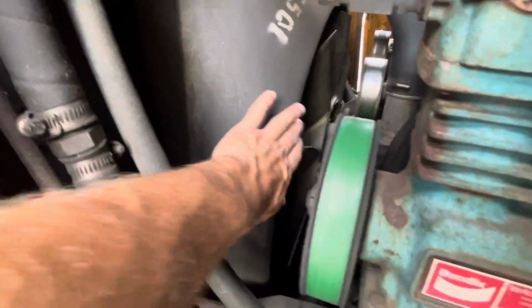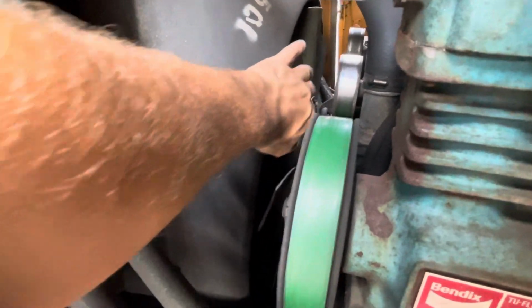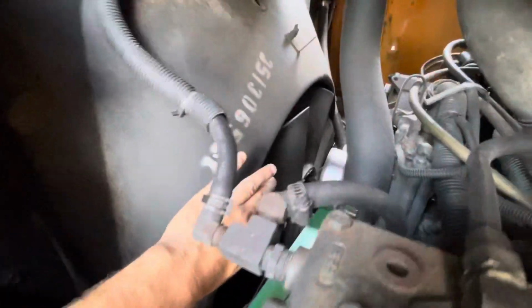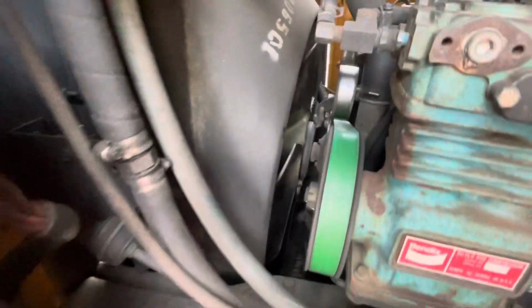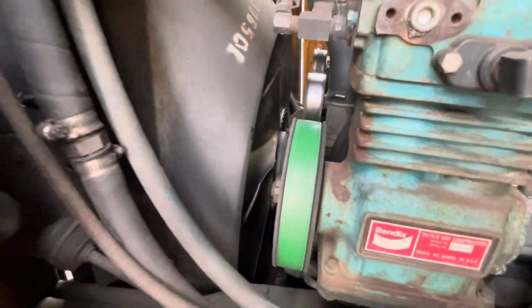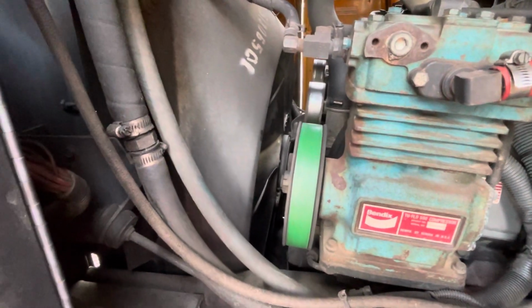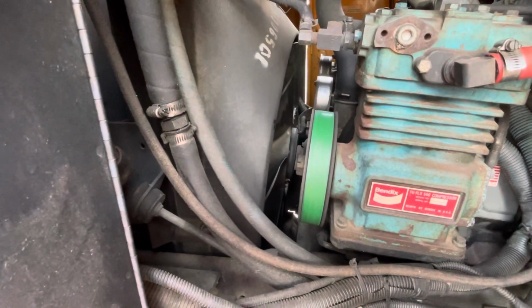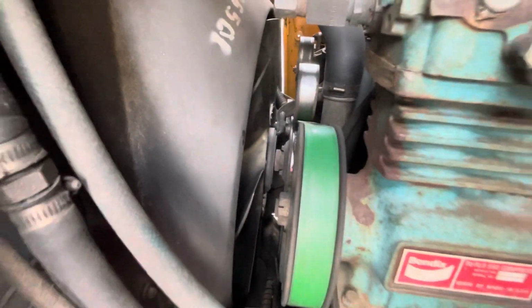The fan is working. It's not a hydraulic fan clutch. It's not a... what's that other word? Cannot remember. It's an electric, magnetic engaged fan clutch. Viscous fan clutch. That's the other one where it has a fluid that automatically senses the temperature and engages. So this one doesn't load up the engine. Well, I guess it does, but it does it via an electric fan clutch. Anyways, T444E tips.